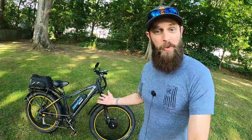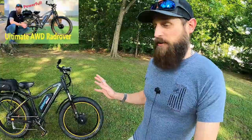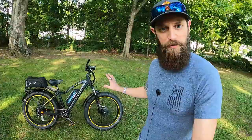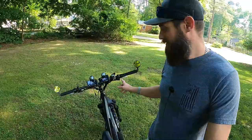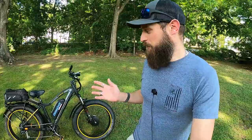What's going on everyone, I'm out for a quick ride on the Citizen 3.0 bike, my custom all-wheel drive e-bike. If you haven't seen the video on that, check it out. This bike runs off two completely independent systems — the front wheel has its own battery, controller, and throttle, and the back wheel has the same. I drive it with two separate screens and two separate throttles: a twist throttle on the right hand for the back, and a thumb throttle on the left hand for the front.